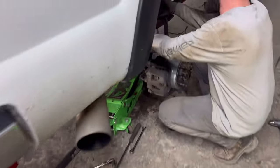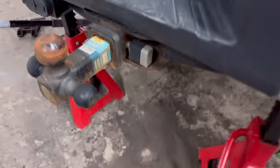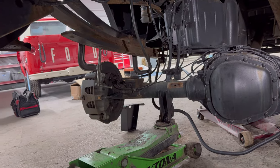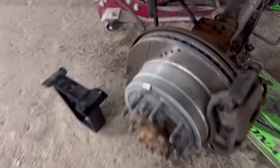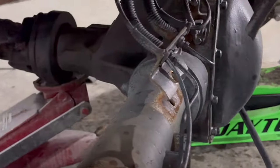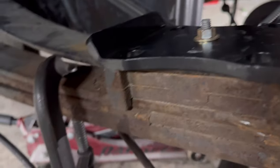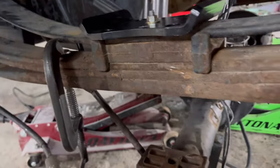Elbows are hurting. Axle drops down right here. You got to use new hardware for that middle plate because Rough Country does not provide it — Jaylee's truck they didn't either. Factory overloads — also didn't have to clamp this but we did it anyway. 16 milli on your vent tube. Rough Country block going in. We're going to add some airbags on top — added a bolt here for the overload so it sits in there. U-bolts going up from the bottom.